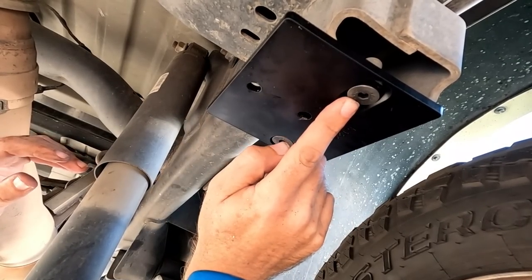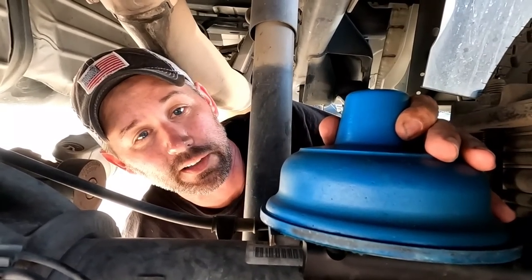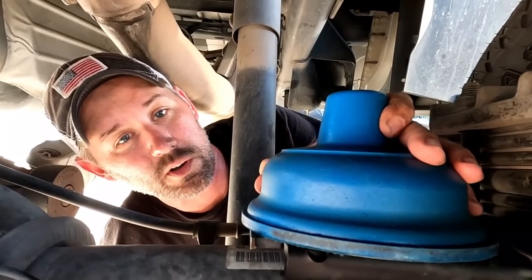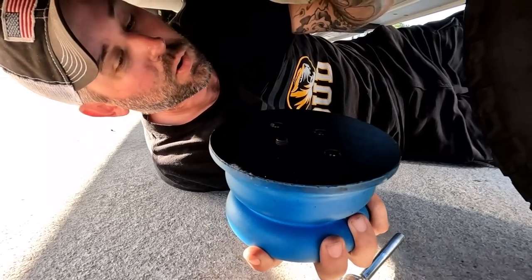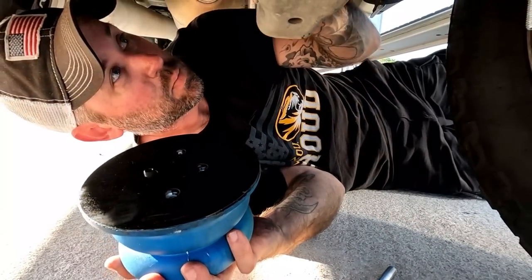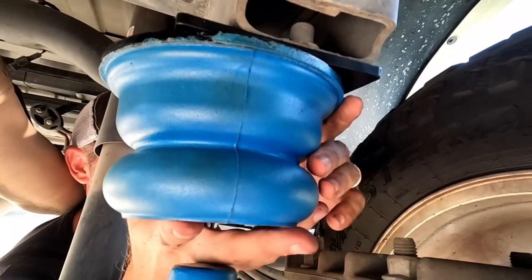And this is where you're going to need your number 6 Allen wrench. Now this bottom portion right here is going to look like it's canted toward the front of the truck. And that's right, it's supposed to look like that. It's by design. So if yours is canted and looks a little hokey, don't worry, you're doing it right. Right on the plate, there's a little bolt. This little bolt's going to seat into the top of a hole there, which is going to line up this bolt that goes into the top of your plate. I'll show you what I mean, if I can line it up.